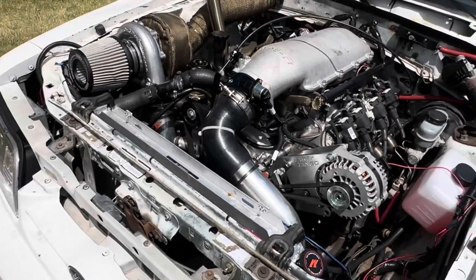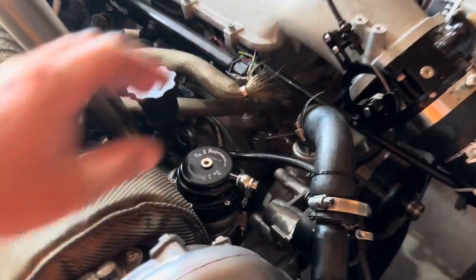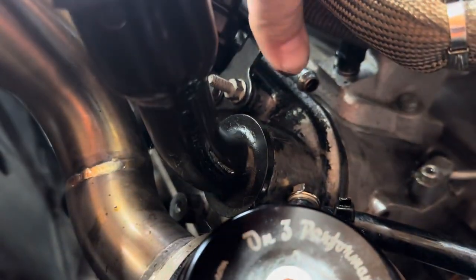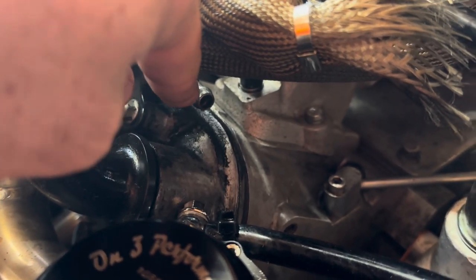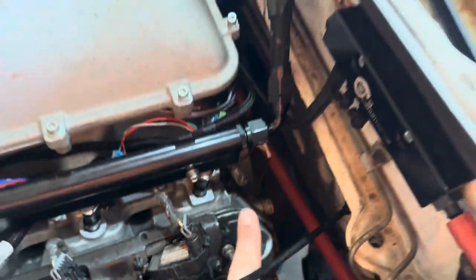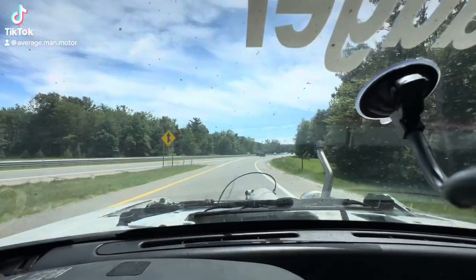And you know what the cool thing is? That white smoke you saw is the breather for the crankcase pressure. So the two breathers that you see are this one right here, and this one actually shot oil out. As you can see, it's oily around my fill. I actually thought this was loose and there was oil coming out of this. But there's also oil sitting down here. I cleaned it up. But that means it's coming out of this breather here, which is supposed to, because I'm running an open circuit, just venting it. But the smoke that you saw came from this breather. And that just came straight up and went over, because I looked at the video and it was not coming from the front, but from the rear there.